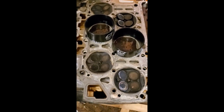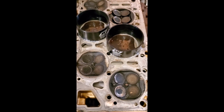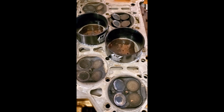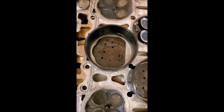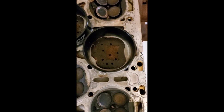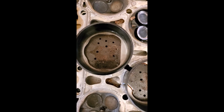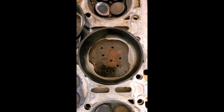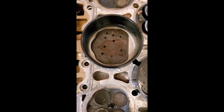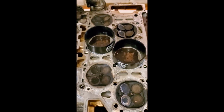Preparing to pour the molds now for my second stage. I drilled holes into the original casting that I poured, and of course I did not want to use my brand new piston ring tool, but it worked out great because it highlights the diameter of the bore, and it would allow me to simulate a piston perfectly for the dimensions of my bore size. So I took one for the team. Of course, I just had to clean it up good, but I didn't want to do it.